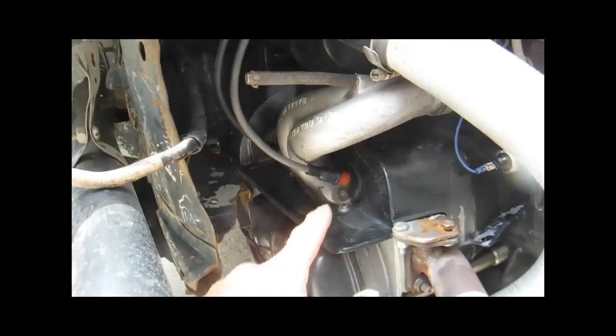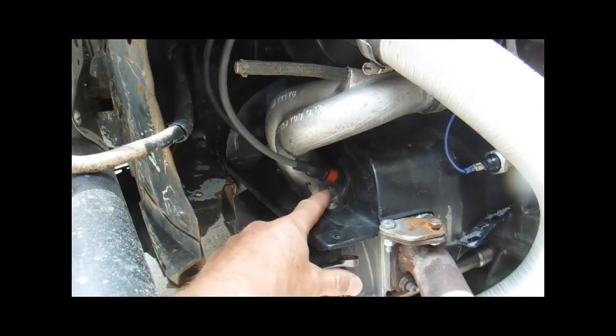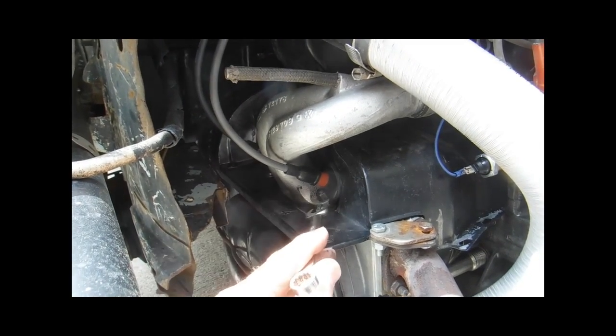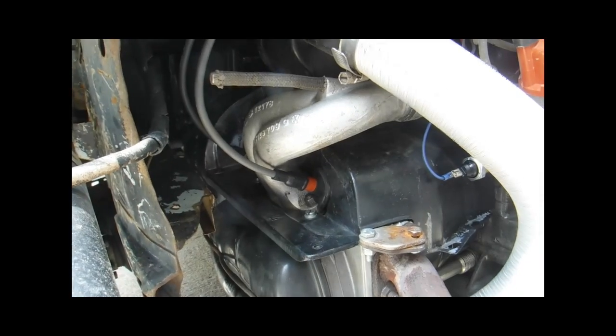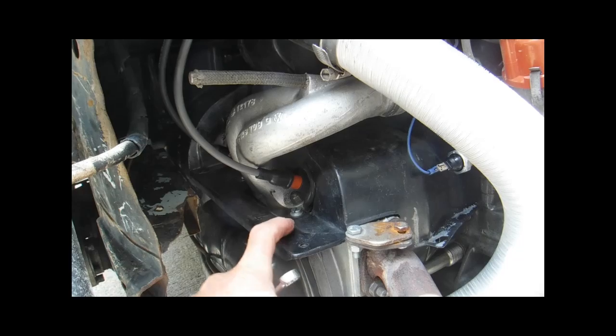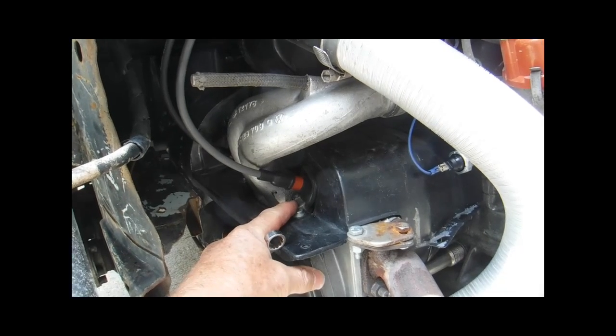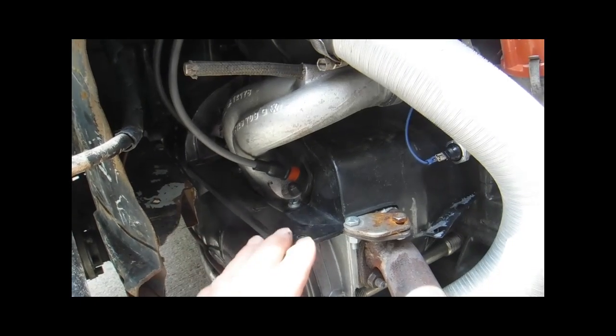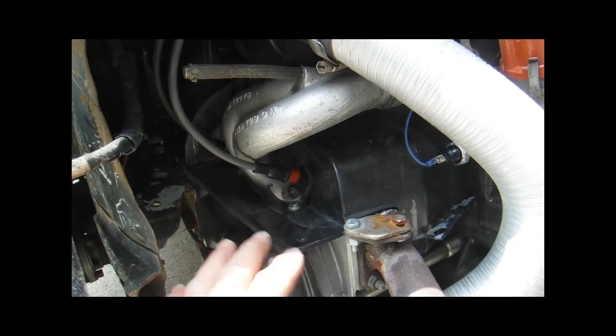I'm always changing things around. Now here I see that I've got the stock intake manifolds, and I'm using the 11mm wrench size nut on it. They're still 8mm studs. Now these are CB Performance heads, and the studs are a little bit longer. These are the 40x35 heads. I don't want to confuse you with this stuff, but it makes a difference on accessibility.